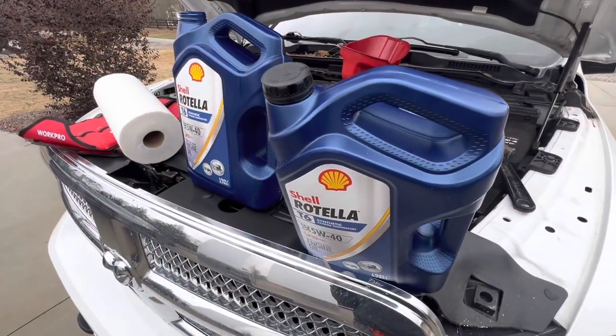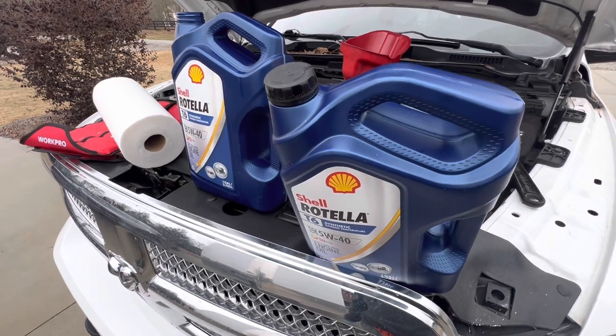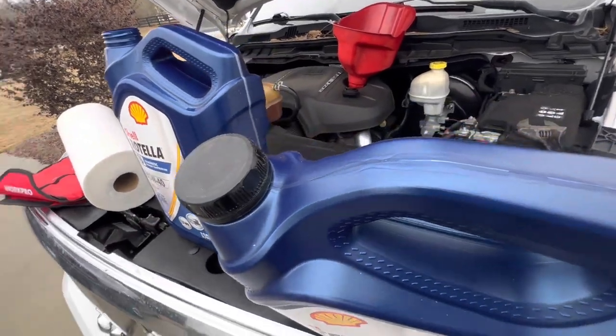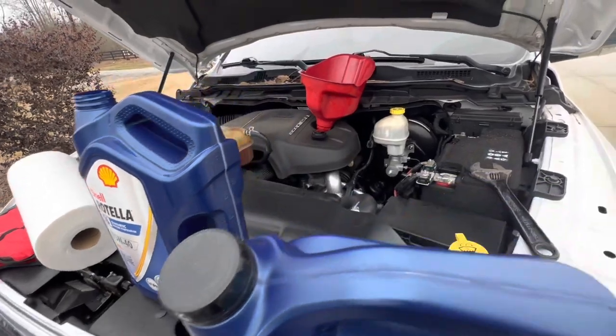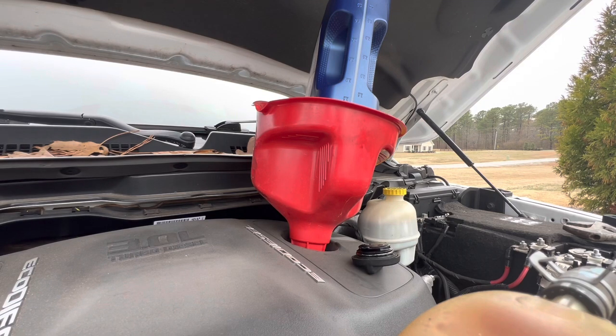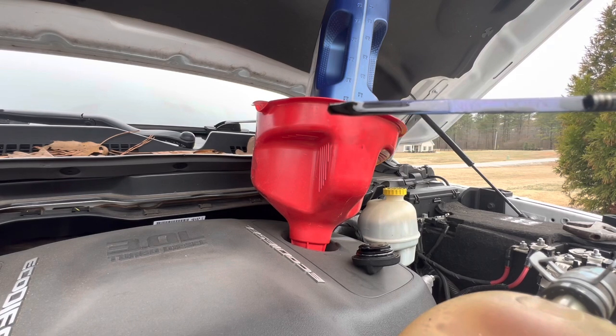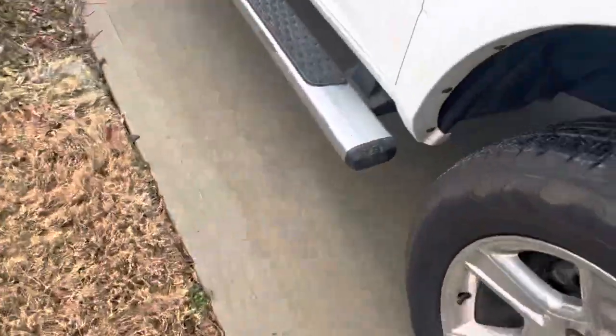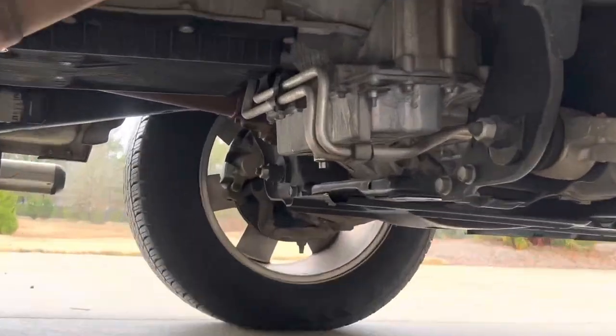Let's fill it. With an oil change, you're going to need 2.25 gallons — so this is a gallon, this is a gallon, and then you'll need a quarter of one. That's with an oil filter change — that's how much it takes. Two gallons are in, I think we're going to be low. Yep, we're at the minimum right there, so we need a quarter of a gallon. It takes about 9 quarts or 2.25 gallons. She's good to go, she's filled back up. No leaks.